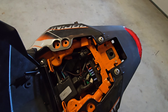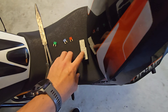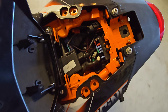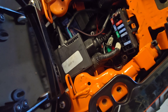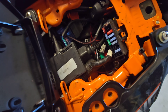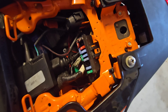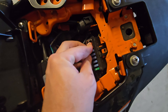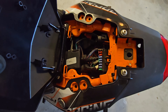It's important to note that when you pull these out, keep them in the right order — these are different rated fuses. You can just look at the fuse box label if you get lost. Fuses are out. I like to pull them for at least one to two minutes so it gives time to drain any excess power to the ECU. We're pretty much there now, so I'm going to go ahead and insert these back in. This is my spade connector for my Power Commander — I'm actually going to leave that off for now and come back to it a little later.